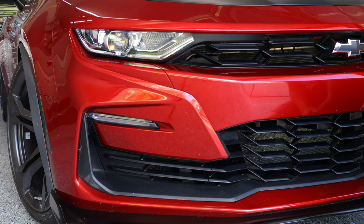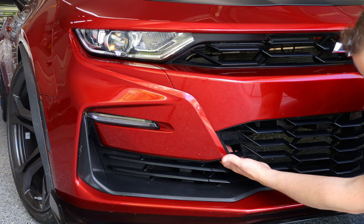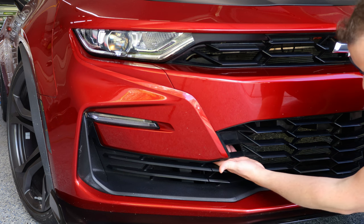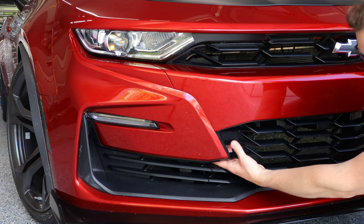One of the tricks that I've learned when taking this part of the grille on and off so many times prepping for a track day is that if you can reach your hand underneath the part of the grille that unlatches, then if you count there's one opening, two openings up from the bottom, there is a little tab that you can grab down here and pull down towards you or towards the ground.